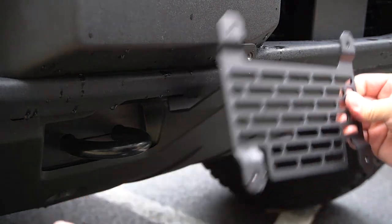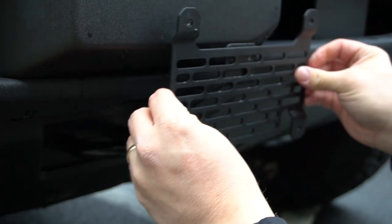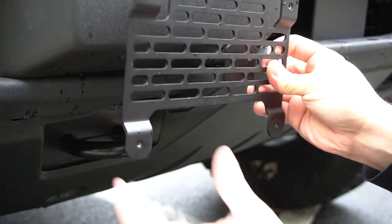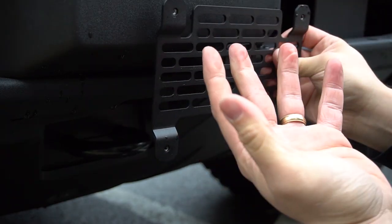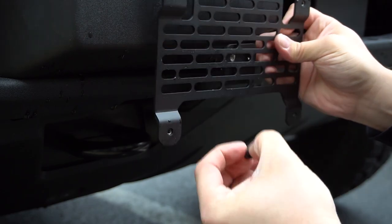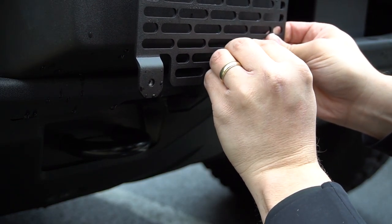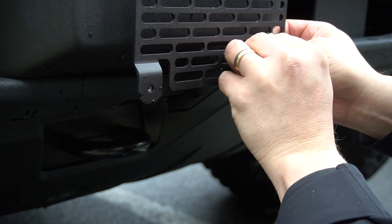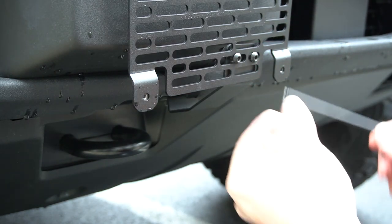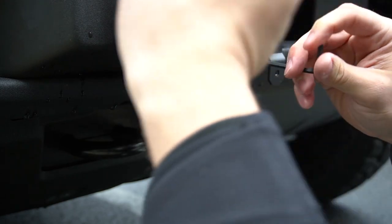With the mounting bracket installed, the next bit of adjustment is the backing plate, which can be mounted anywhere you find a slotted hole. If you're looking to get it a little higher up, you might do something like this; a little lower down, something like this. Off to the sides — it all depends on your accessories and personal preference, and it can be changed later too, you just need to pull the license plate off to access these two holes. I'm going to position it so the license plate mounts a little bit higher over the plastic trim piece. If you have trouble starting the screws by hand, it's because of a little powder coating in the threads — you may need to get them started with your four millimeter allen key. Go ahead and tighten these down, then take a step back and make sure it's straight.